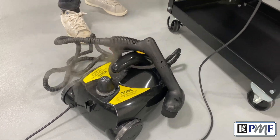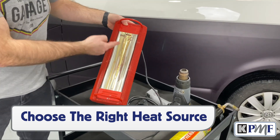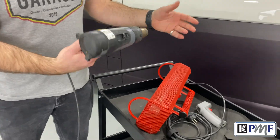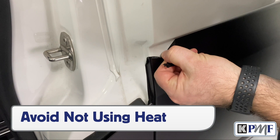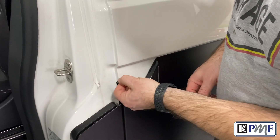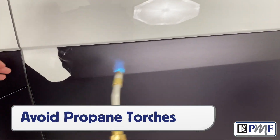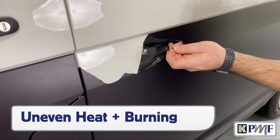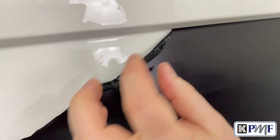It's very important to choose the right heat source and there are three: the pod steamer, an IR heater handheld or on a stand, and a heat gun that has a variable heat setting. Propane torches should be avoided. Always avoid pulling the film off the surface with no heat because it'll come off in pieces and leave residue behind. Propane torches warm the film at uneven temperatures which can cause the film to tear, and the propane torch can burn the film which will cause it to break even more during the removal process.